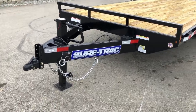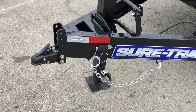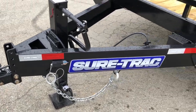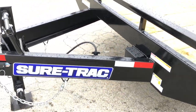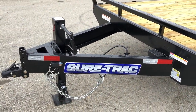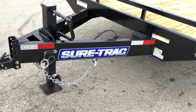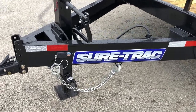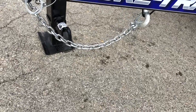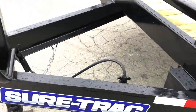Let's start up front. It's got a six-hole adjustable coupler — notice it's a cast coupler, not a stamp that you sometimes see on more economical units. It's got an 8-inch channel tongue and a 12k jack set forward. We like the set-forward style jack placement because it's easy to get to the leg. The leg on these is spring assisted. It's got your safety chains with a 3/16th hook — a nice heavy duty hook setup.